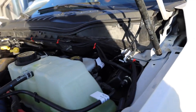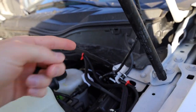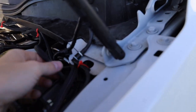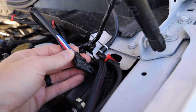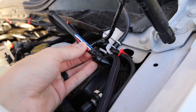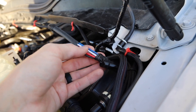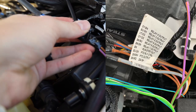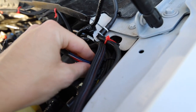I took this cable off — it connects to the cable and splits in two. One goes to the power straight to the light bar and the other one goes to the module switches. You basically cut those off. You don't need to use the red or the black — red's power, black is ground. Just cut them and put something over them so they don't touch anything. The white and the blue are what you're going to tap into on the other ones, and I think it's purple and orange, and green and orange.